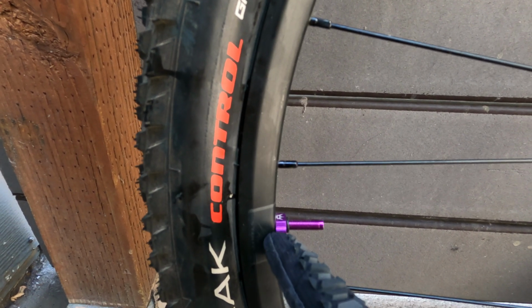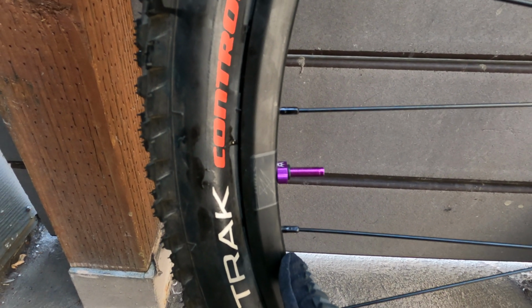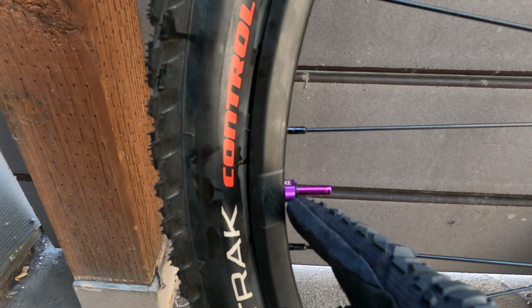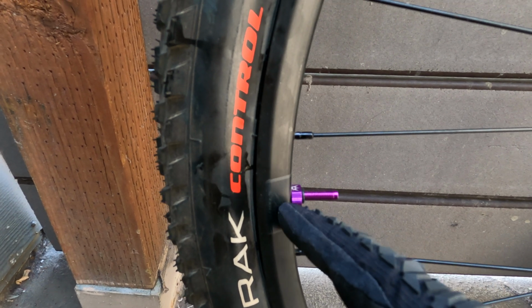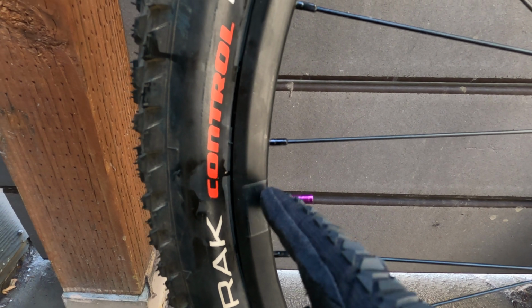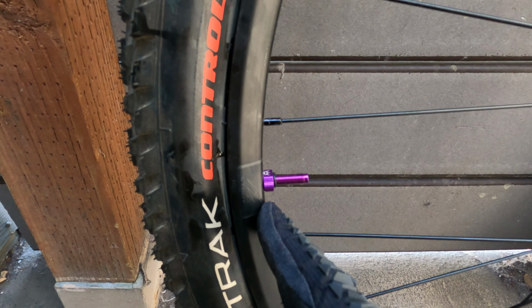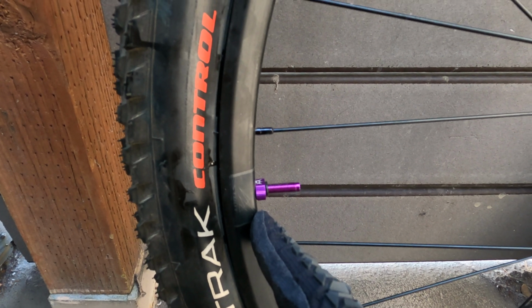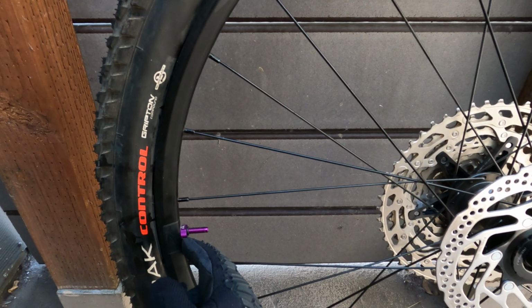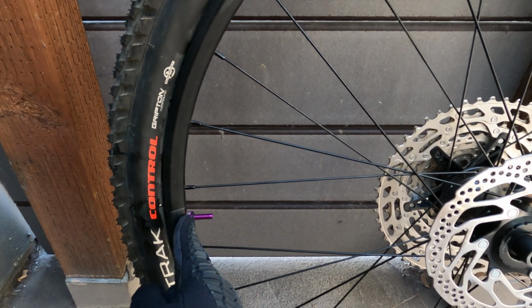That gasket is supposed to be under there, but because of the shape of the rim, I just have it there not to lose that little gasket, but it should be sitting under the nut. But if it does sit there on this particular rim, it will not seat properly. Now, I know it's not leaking air from here. I already checked that. I already took the tire off the bead.